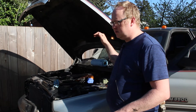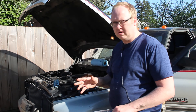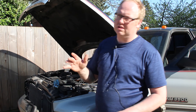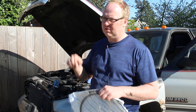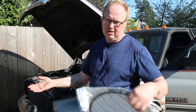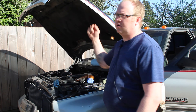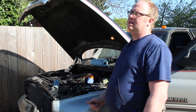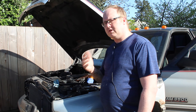So now I have to go back to the drawing board. We're back from our first run — didn't go so great. We had some lower pressures. Idle pressure was good. When I spoke to Summit Transmission, I told him the idle pressures. He said if that's good, your pump's okay. He realistically said if you change the valve body like we did in the last episode, you don't necessarily have to do this if you know your transmission's good and you've got good pressures. But how do you know without checking the pressures? So now we're going to adjust this cable, go for another drive, and then come back and assess what the changes were.